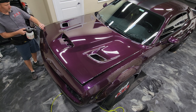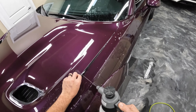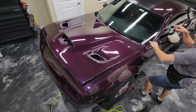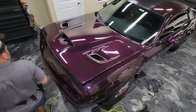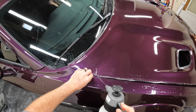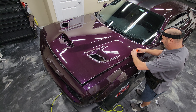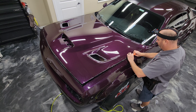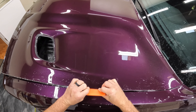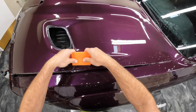Once you've got the whole edge trimmed off all the way around, we're going to spray some rubbing alcohol or tack solution in there. We're basically trying to eliminate any of the soapy water, as well as get that adhesive to be a little bit more aggressive so we can go ahead and pre-wrap all these edges. Once the pre-wrap is complete, I'm going to lift the hood and let it sit until all the moisture on the edges is dry. This right here is what we call a pre-wrap — taking that edge of the material and wrapping it around to at least the side of the hood, if not a little bit underneath.